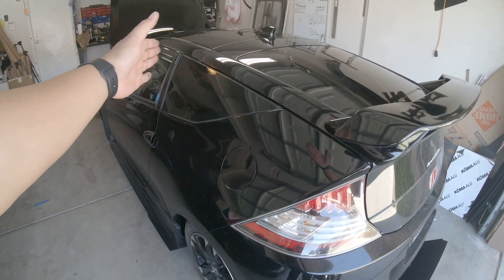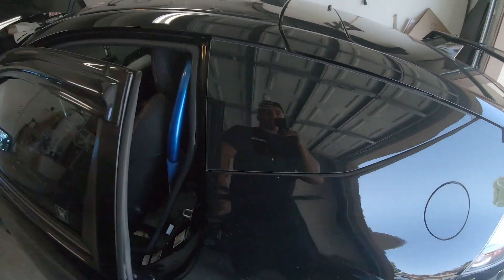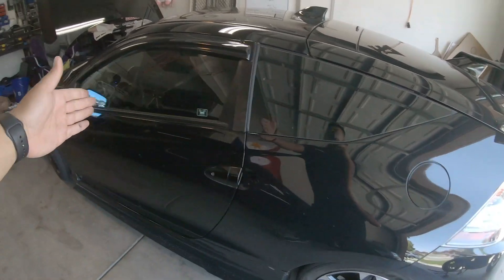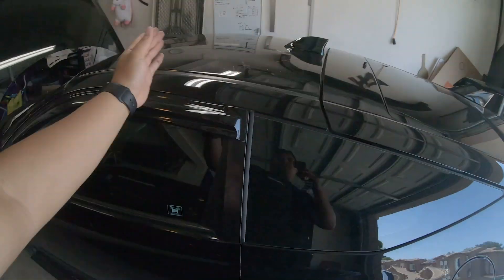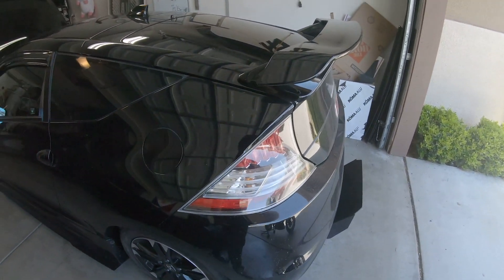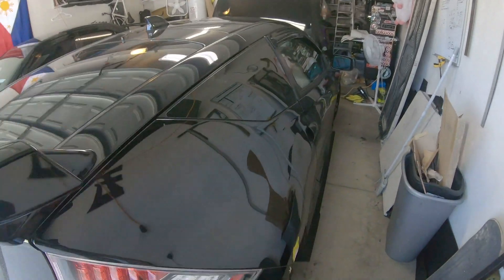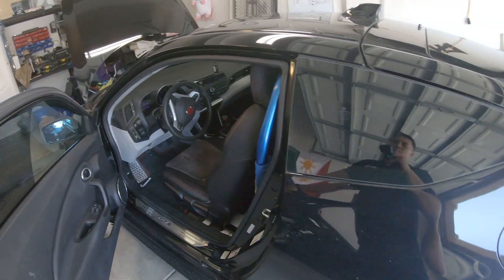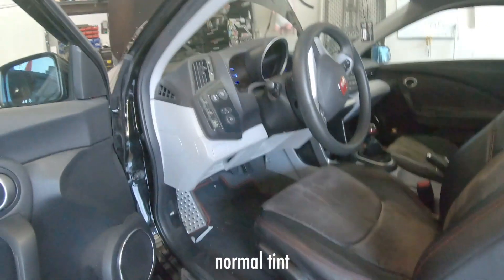Number three — if you own a CRZ you know this car is beautiful, but the hatch glass on top gets brutal in summer if you don't have tint. The back window is almost 40% of the entire cabin, and with the sleek front window you've got heat hitting you from the front and back. Number three is ceramic tint. At a minimum get the rear hatch, the front windshield area, and the side windows — that'll keep out the most heat. It should be around $200 for three windows with ceramic. If you go cheap with regular tint you won't get that heat reduction.